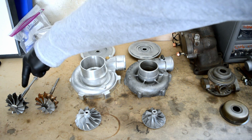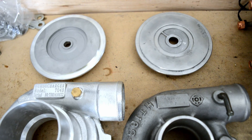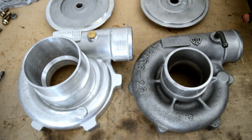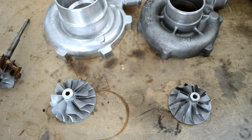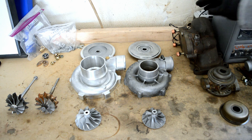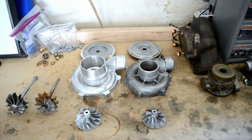Here's the new and the old turbine wheels. This is the new compressor backplate housing and wheel. This is the stock backplate housing and wheel. Obviously I'm reusing the stock turbine housing. This is the CHRA, and this is the heat shield for the CHRA.